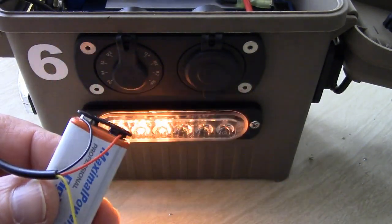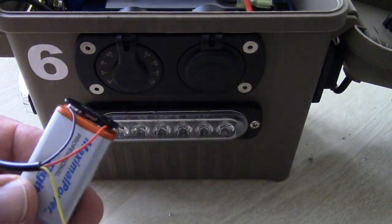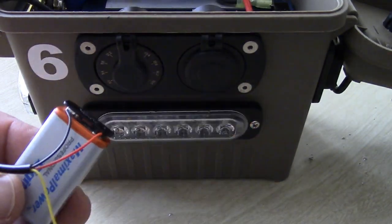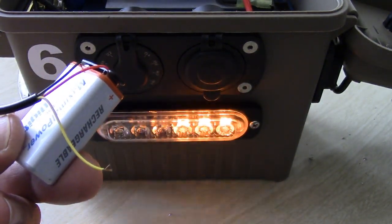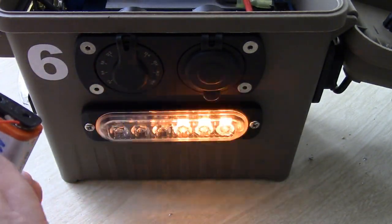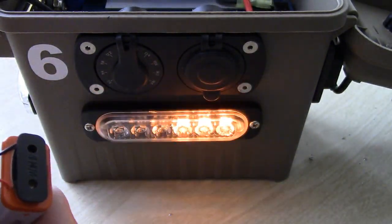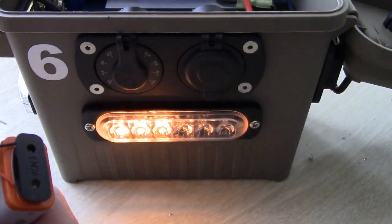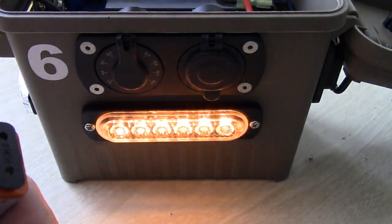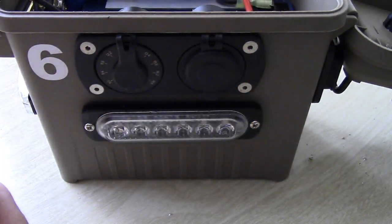I've installed the negative and positive to a 9-volt battery, and as you can see, it's got a pattern, and then it oscillates back and forth, and then it goes to the same pattern. Okay, and we're not doing anything with the yellow lead. It's just kind of sitting there. But if you take the yellow lead, let me do this in a way that you guys can actually see what I'm doing, and I'm going to touch it now to the negative terminal, guess what? Changes the pattern. And it's going to stay like that until you touch it again.